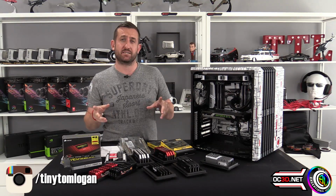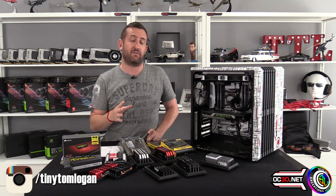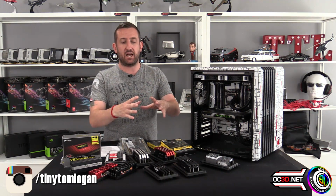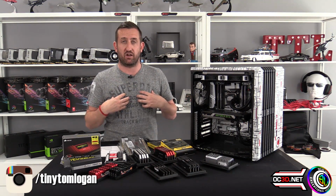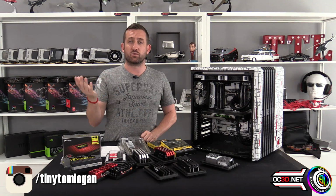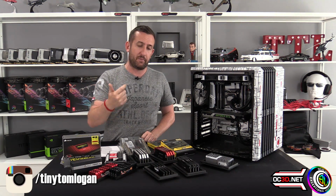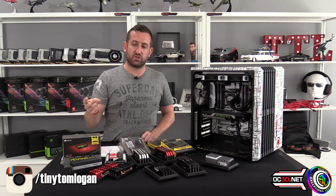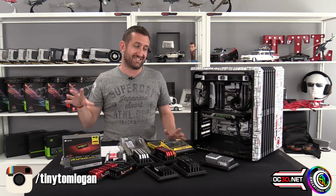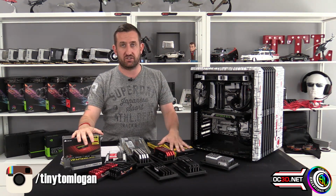The only real safe place is 2800 megahertz, and that is every other one that I've got here. They all seem to work, I didn't have a problem with it, and you could overclock with them, and the temperatures were good as well. So 2800 megahertz for this is the safe zone as far as I'm concerned. One of you guys might get some obscure memory kit and find a place where it falls over. I obviously can't test everything, but as far as the sticks that I've got, and I have got G-Skill, Corsair, Kingston, Crucial. I don't think I've got Corsair in 2800 megahertz, although I could have a look, but I've tested quite a lot of 2800 megahertz kits, and it went in fine and worked. And like I said, you've got the overclocks and good temperatures as well.